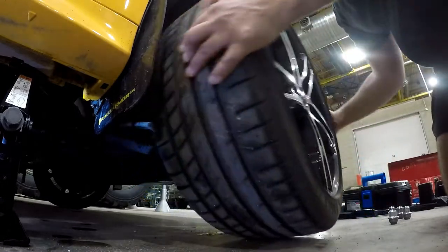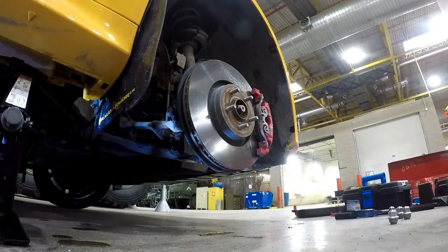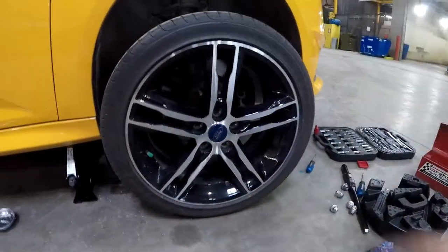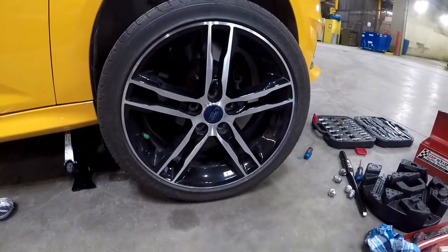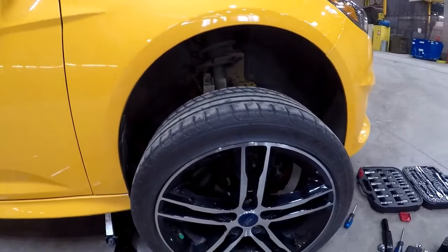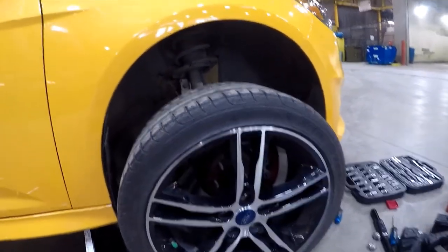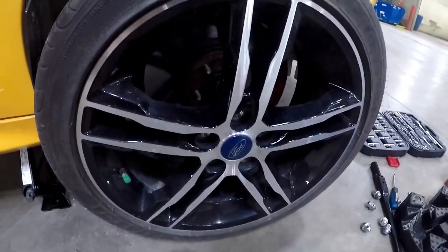So once the tire is off, here you go. All right. So the next thing to putting your tire back on is look for identification marks around the tire telling you which direction the vehicle moves. So if you've mixed your tires up, you know you're not putting them on in a different direction, because every tread is made to go a certain direction. You're not supposed to drive in reverse like 50 kilometers or you ruin your tire, because it's made to go forward. So now we'll just throw the tire back on, and I'll explain everything I'm doing.